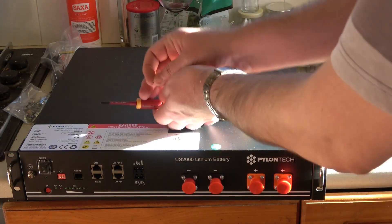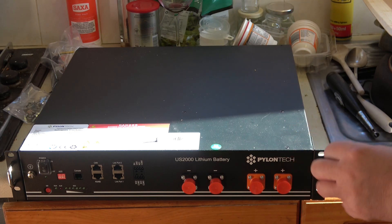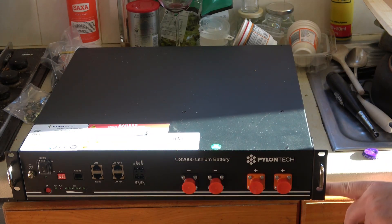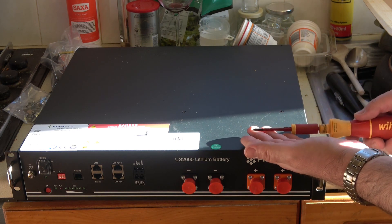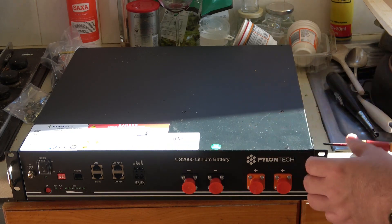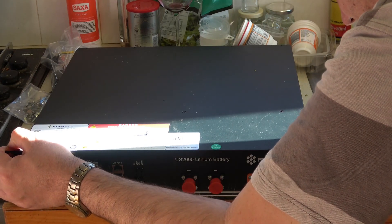First I need to take off these rack mount brackets. There are four tiny screws on each bracket and you need a Phillips head number one screwdriver — not a Pozidriv if you're in Europe. Make sure you get really good purchase on the screw before you try to turn it, because they've sprayed the surface and the screws are slightly locked in place. They're very soft screws — if your screwdriver slips the screw will be ruined and you'll have to drill it out.